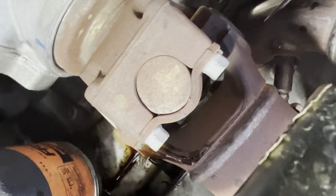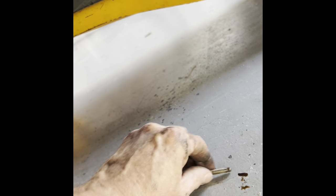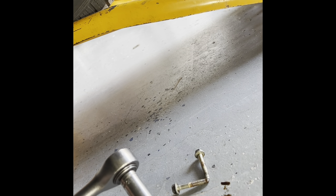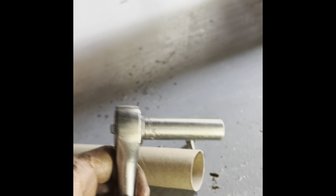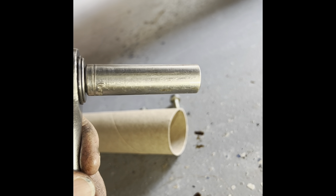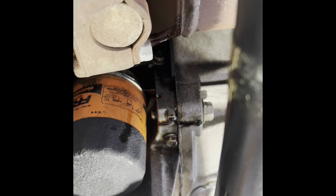To get the 10 millimeter bolts out - which are these right here - be careful cleaning them off. The guy at the parts store told me there's something on here like a sealer in the grooves, so don't wipe that too hard. All I used was a 3/8 drive with a very long, almost two-and-a-half inch deep well 10 millimeter socket. You just have to finagle past this drive shaft - it's a little difficult to get up there, but once it's loose enough you can literally just take off the ratchet and use the socket itself to get the bolts out.